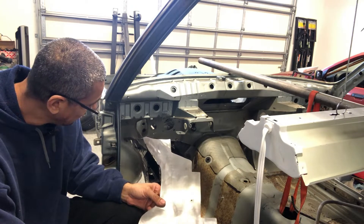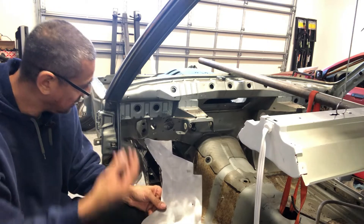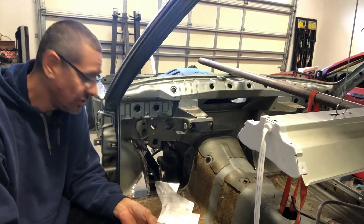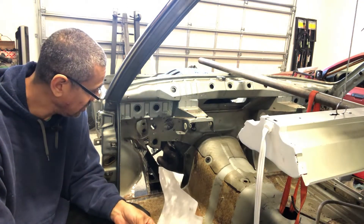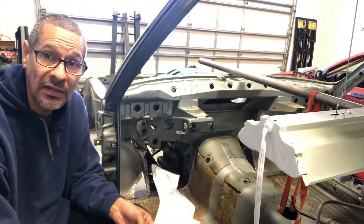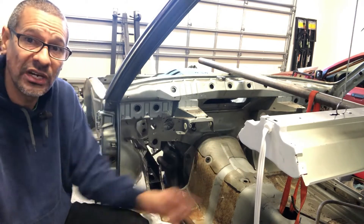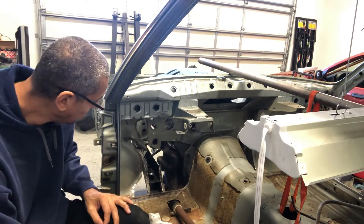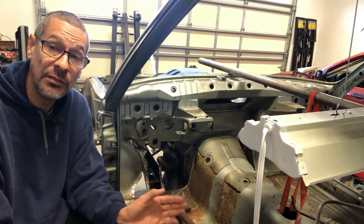As I sat there with the piece laid in place and the gaps looking pretty close all the way around, I started looking at it and thinking I'm going to have to cut into the firewall — and how far am I going to have to go? That's when I stopped and decided I need to get the engine in place, get that sorted out, and technically cut part of the firewall out so I can get the engine situated to where it's going to be at its resting home. So what I ended up doing is cutting the firewall where the exhaust goes on both sides, so I could get the engine in. Nothing on the bottom has been cut yet.